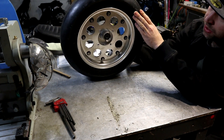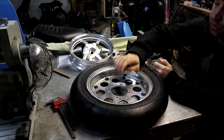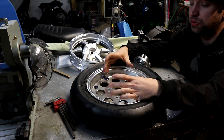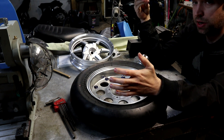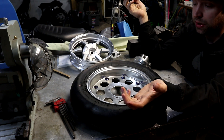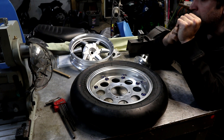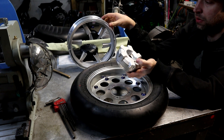That's pretty easy to solve for the front — this fits basically right into the wheel itself and bolts in with four bolts. The problem comes in the rear. I have seen adapters made up over the years that do allow fitting of a monkey bike wheel onto a rear. On the Spree, for example, I actually have a Kimco DD17 hub, which is the standard hub that a lot of aftermarket wheels for Dios use. It has a much bigger center hole and the bolt pattern is 4x137. Those are pretty readily available but the wheel selection isn't as appealing to me.